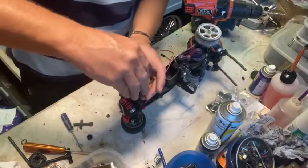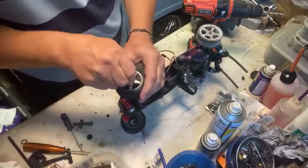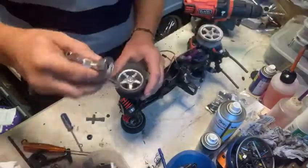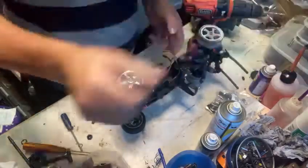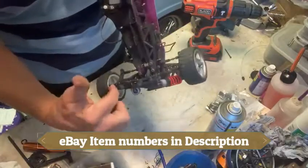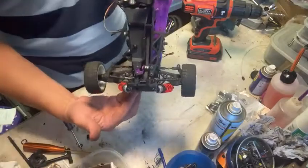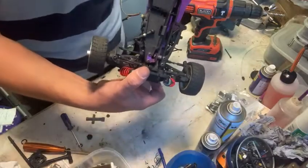From there the nut can screw on all the way down, and I'll tighten that up with a pair of pliers or a spanner — you need a 10mm one for this, the same size as a glow plug tool. You can see now that the wheel spacer is fitted and it's spaced the wheel out on this side by 20mm, so it's slightly further out on the steering arm than the other side. It works exactly the same way whether it's a 15mm, 20mm, or 25mm extender.